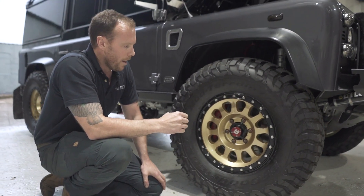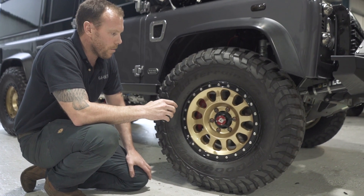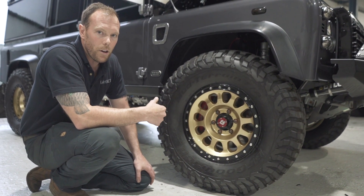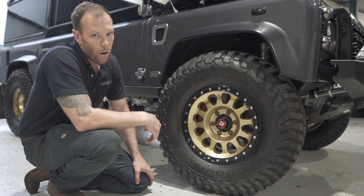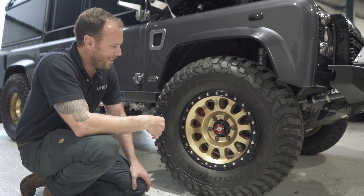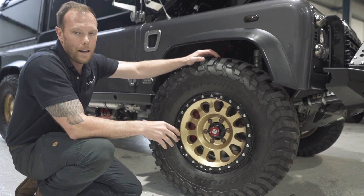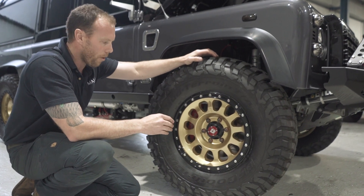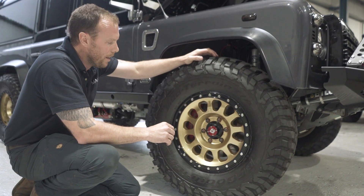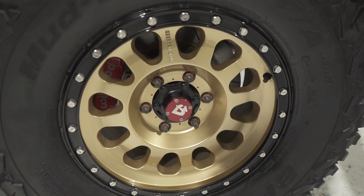To match the horsepower of this car we needed some serious axles, and I know our customer Will is going to give this car absolute hell. So I approached my friend Pierre — he owns Arsini in Italy. These axles were handmade in Italy. I told him I needed hooligan-proof axles, because that's exactly what I'd class Will as — he's renowned for a heavy right foot. So we went with 35-spline Y61 handmade axles with upgraded shafts and upgraded drive flanges. Just look how beautiful these are — handcrafted. That's Ace Off Road, which is also Pierre's company, and they're running 300M shafts with ARP bolts.